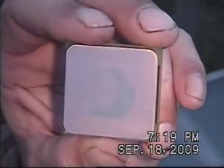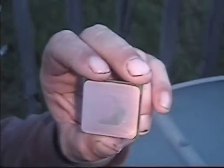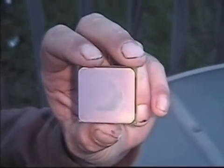Right now we're going to keep on doing that. As soon as that's done, we'll switch over to the 800 grit sandpaper and show you the CPU before and after the 800. Alright, this is what it looks like after the 600 grit. As you can see, you can now see copper through it, except for the top part which is still a high spot. All the high spots obviously go down and reveal the copper below as it's being made flat. I'm going to go ahead and do the 800 grit now and show you what it looks like after.